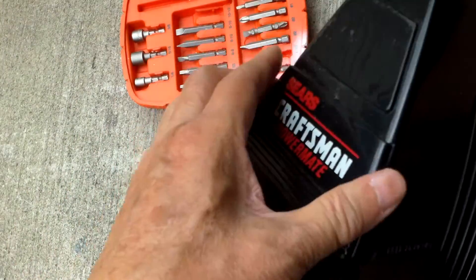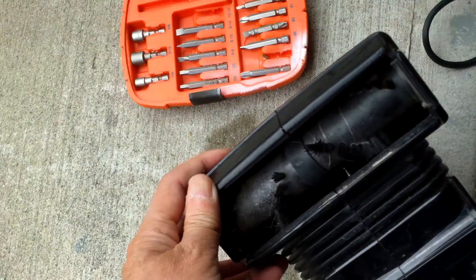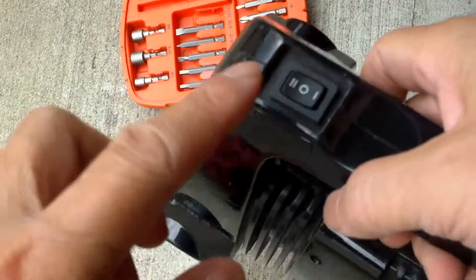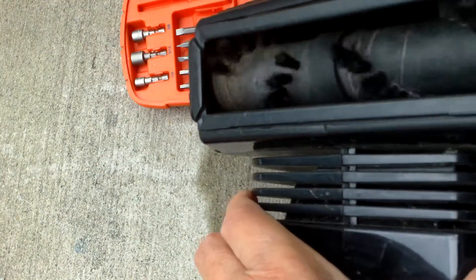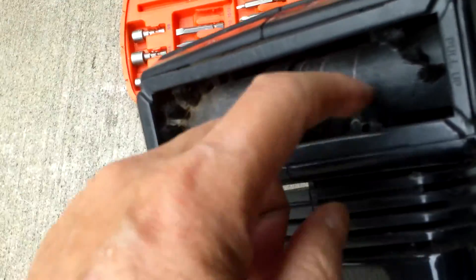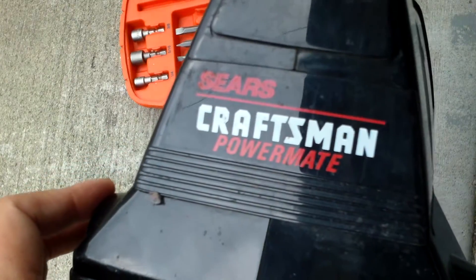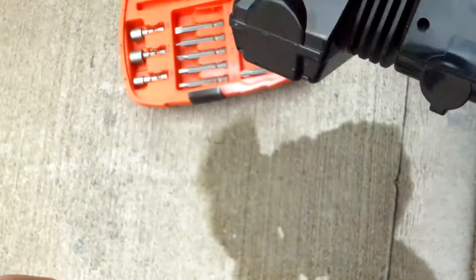After you screw the thing back in, make sure it's tight. Check the belt position and check the arrow is pointing down. Put the cover plate back on and push it in — it just snaps in. Plug in your vacuum; this is two speed. Then just look at the rotation of your roller — it's supposed to rotate this way, downward. So now it's working again. Sears Craftsman Power Mate — I wonder if they still make this. Alright, thanks for watching.